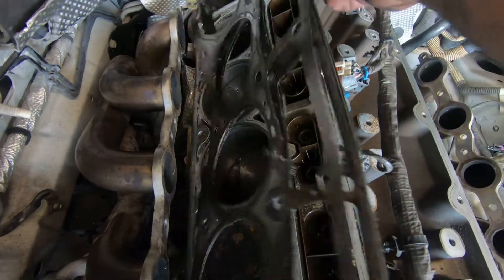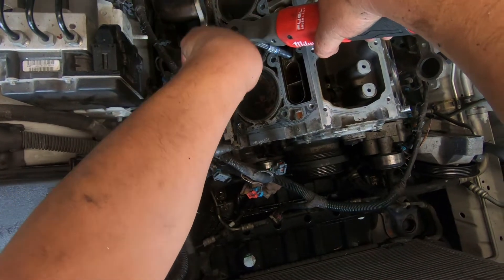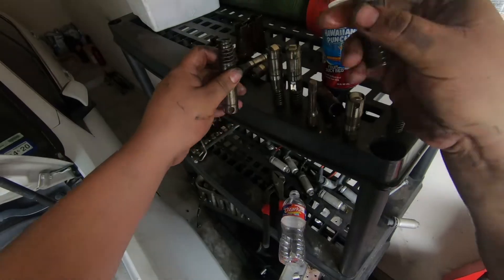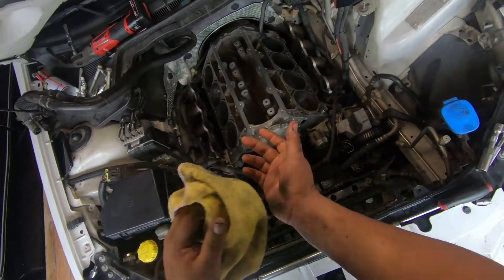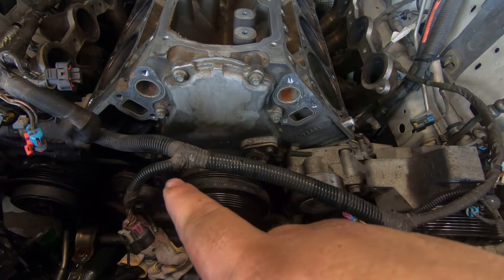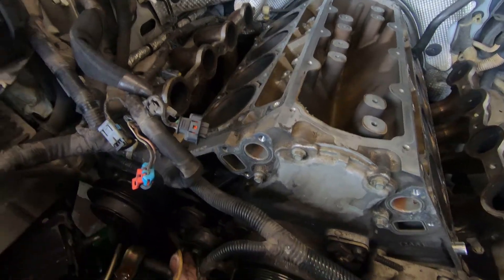Finally off. Let me go ahead and remove this, clean it up a little bit, and then remove the lifters and see if any of those are bad. We're going to have a big mess here in the garage. That lifter over there - that's not a good one. And it was not even an active fuel management failure, which is a weird thing at 160,000 miles - active management was still good on it. So all along it's just a regular LS roller lifter. For the next video it'll be the pulley remover, front cover removal, then remove and inspect the cam, and try to remove the stuck lifter with maybe a pry bar - hopefully I don't mess up the bearings. All the front end stuff is gone.